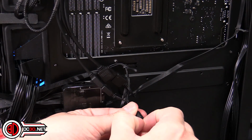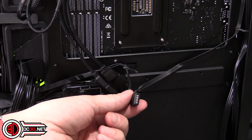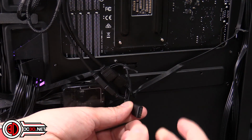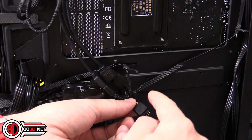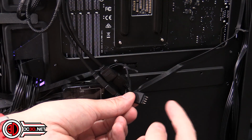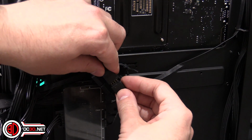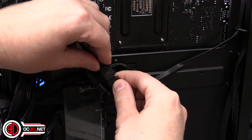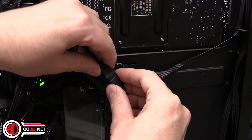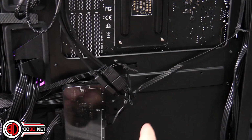And it's basically a standard RGB 4-pin connector, which you can connect into any motherboard really, or anything with an RGB out. Most motherboards you can adapt the colours now, because each one of the pins stands for 12 volt, and then you have RGB, and the RGB can be any way around. So a lot of motherboards now do allow you to basically set them up. I'm trying to put this back in at the same time as talking to you. You can set them up and configure the cables. Now, so that's what's on the end.